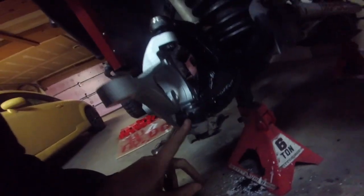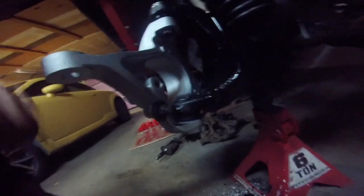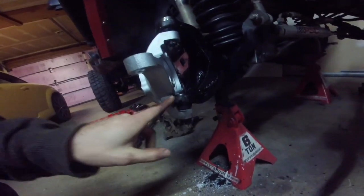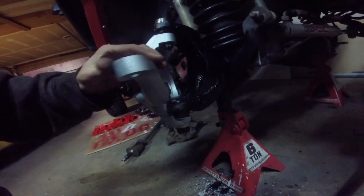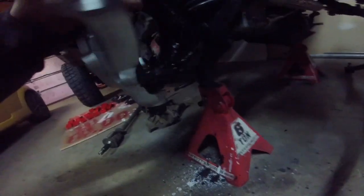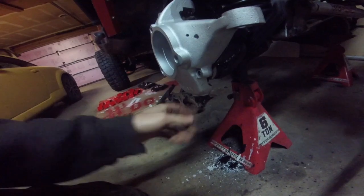These knuckle stopper bolts, you can see how they work. They're 9/16 inch, but I had to use a tap to start the threads for this to thread in. So it's 24 threads per inch. And once I got it started, I was able to thread that in. Anyway, I got these torqued, I got the cotter pins in, and now we're ready for the next part.